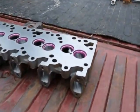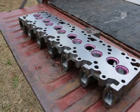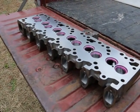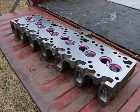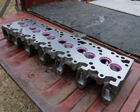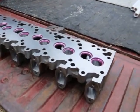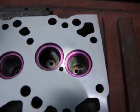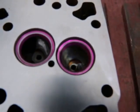We want to give credit where credit is due — this is what we've learned from Competition Diesel and the Cummins forums, reading literally hundreds of hours to figure out how to do this correctly. This is an OEM Cummins head. We tried a Chinese head and maybe that'll be a totally different post. That's why we switched back to an OEM head — it had cracks in the valve seats, so we had new seats pressed in and machined, and had the surface decked so it's ready to go back on our motor.